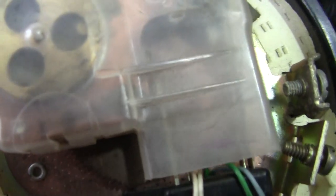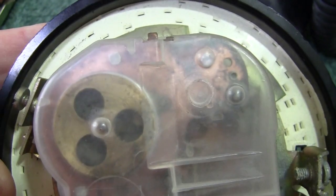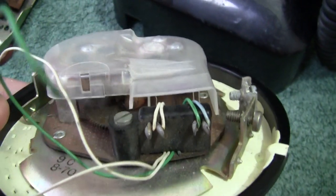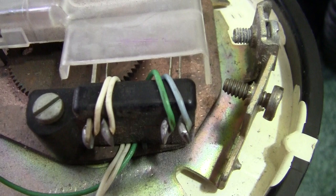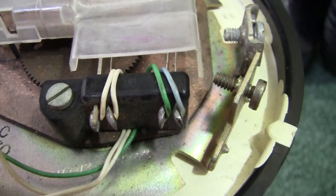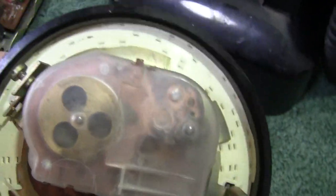We've also got a picture, and in there was the dial, which is dated 1987. There's no name on the dial, which is rather unusual — I thought it would have had Western Electric or something like that, but it hasn't. It's a typical Western Electric type dial. The contacts seem to be okay and it seems fully working. Just one problem — it just needs an extra wire connected up. It's showing three leads coming out and there should be four, so that bluey slate colored one has been cut short, but that can always be extended.